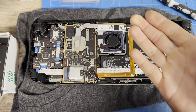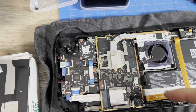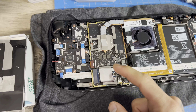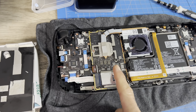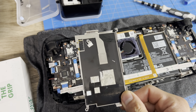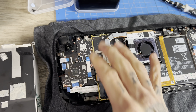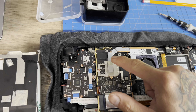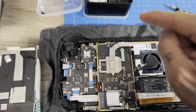We're back inside our Steam Deck. We took off the heat shield and all the thermal pads on it, took some measurements and got all our heights for the thermal pads. The plan is we're not going to actively cool this, but we can make the existing cooling system better. This aluminum is very thin and doesn't transfer or soak up heat very well, so the goal is to take a copper plate, place it right on top touching the APU, the heat pipe, and everything else to transfer as much heat from the lower portion to the heat pipe.